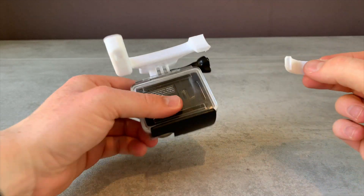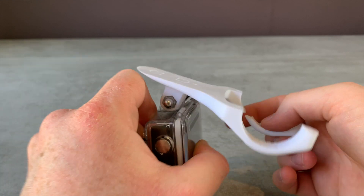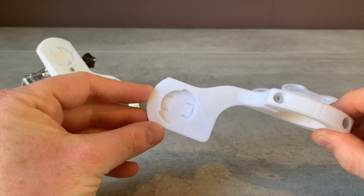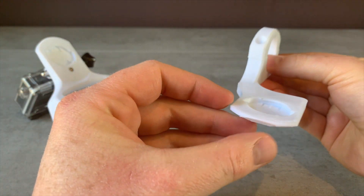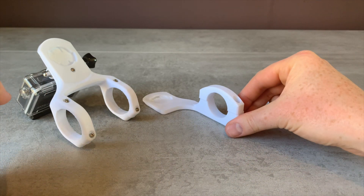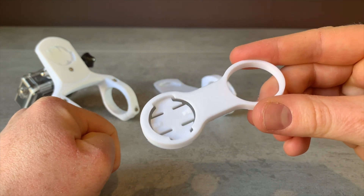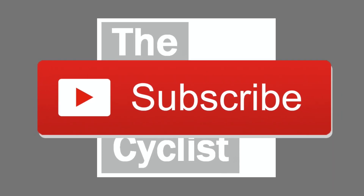You can print them with more plastic in them to make them a little bit stronger. For the two mounts which act as a spacer or top cap, I would absolutely not use a 3D printed version of that type of adapter — even at 100% infill I wouldn't feel confident riding on a home-printed part. But for the other two pieces, for the cost of 20p they work brilliantly. It would be interesting to see how long they last over a year or two of riding — probably not quite as good as the real thing, but for a second bike or commuter bike at 20 or 30p per piece, you really can't complain. I hope you enjoyed this — if you have any questions please comment below, and as always please like and subscribe.